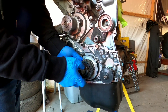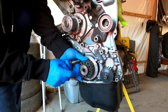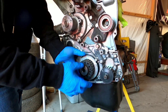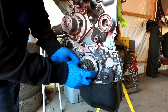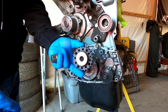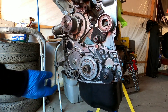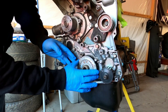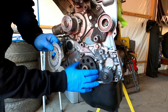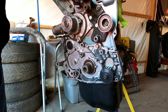We're going to start removing this bolt. After you remove it, there is a washer here — it's a big washer — but sometimes it gets stuck with the sprocket, so I'm going to remove it altogether. Following after that there's a plate, and then you have your balance shaft sprocket — you're going to want to remove that as well and put it to the side.